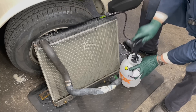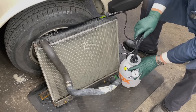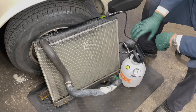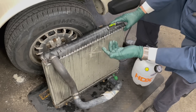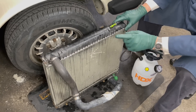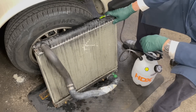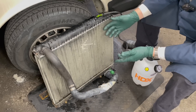Oh no! Heaven help us all. I just saved myself about two hours of work by not installing this radiator — I would have had to take it right back out. You can hear it hissing right out of the top. It's leaking in the same place as Spencer's radiator. This radiator's been sitting around for about five years, and that's why you have to be very careful about buying a used radiator. If they sit for a long time, that seal in the bottom of the tank will shrink and it'll leak right out of the tank. I'm going to have to go buy a brand new radiator.